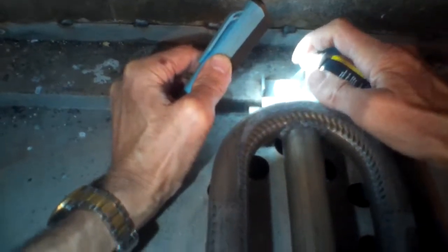We're going to spray a little bit of WD-40 on the screw that holds in the Venturi, and a couple of squirts of WD-40 on the screws that hold on the igniter. These screws can tend to get hot and seized.